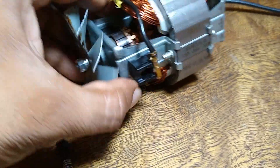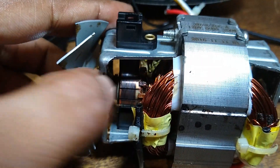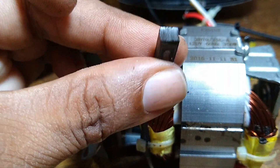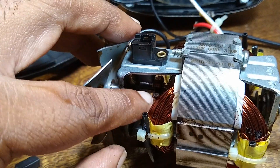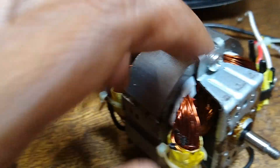So here we see more of the residue. This is the actual motor here, attached to this brand of blender — you can notice it's totally different from the custom brand. What you see spinning here is the commutator; that's where the brushes actually lock on. You get this idea of the semicircle look — it actually hugs around here and allows the current to flow from this point to the armature, which is inside.